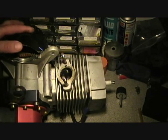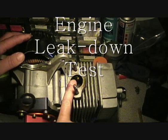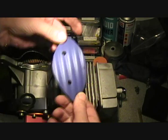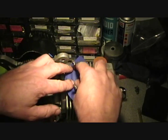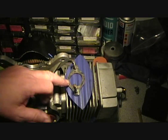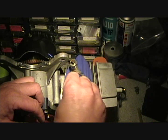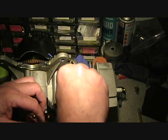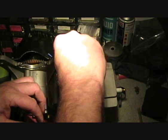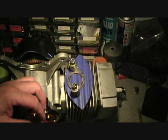Right, I want to show you how to pressure test the small engine — very easy to do. I've removed the exhaust and what we first need to do is cover that up. I've used a piece of silicon rubber off the flange of the exhaust, or you can make a plate and bolt it down. Tighten these up. You can pressure test while it's still in the frame — you don't have to remove the engine.